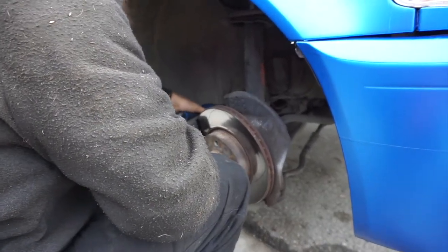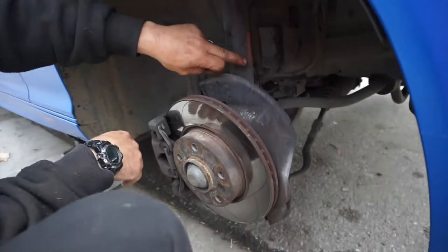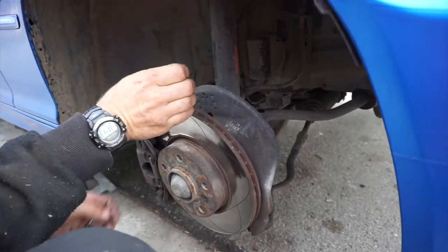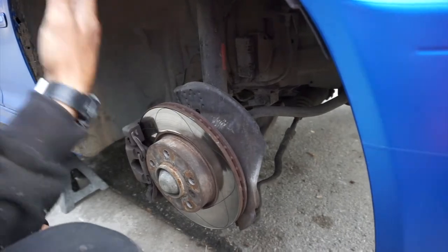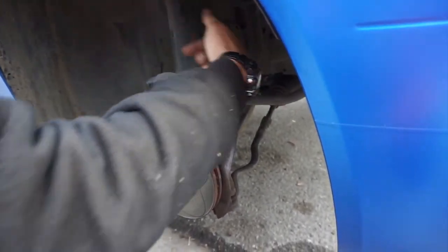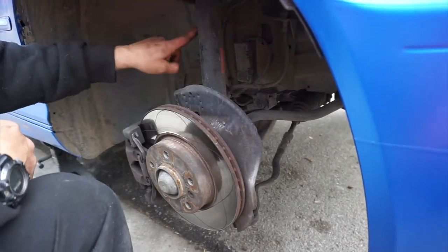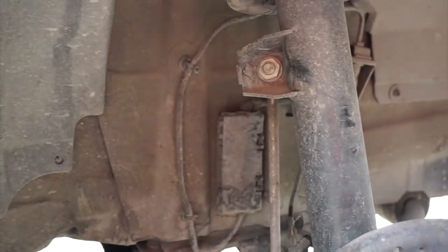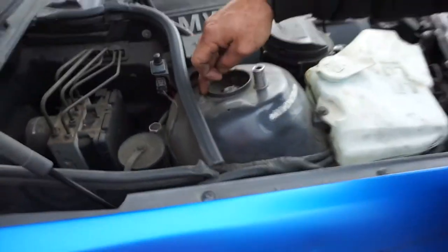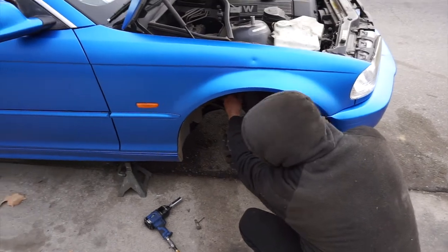Open the 18 and like that it's gonna free the bottom. It's got a clamp — it clamps around the tube of the actual strut itself. That clamp just has a bolt that runs through the backside to clamp it down tight. You pull that bolt right out, it'll let the sleeve open. If it ever gets stuck, you can take a screwdriver, wedge it in between the two halves and it'll open up and slide right out. We still have a link here for the sway bar to remove — probably a 14 or 15. On top you've got three 13mm nuts to hold it in at the top, and that's it for the front removal.